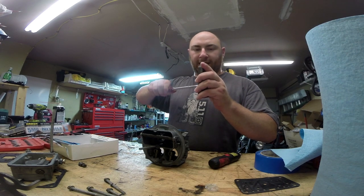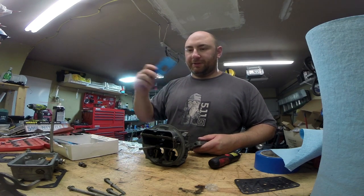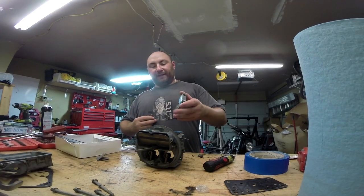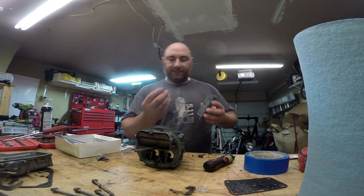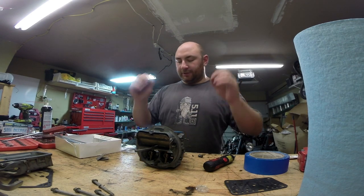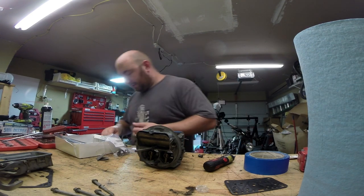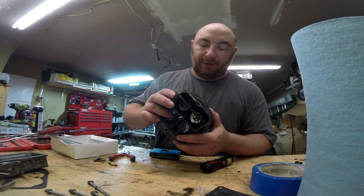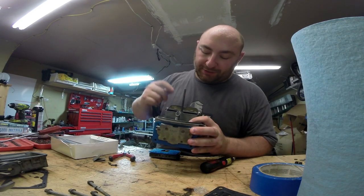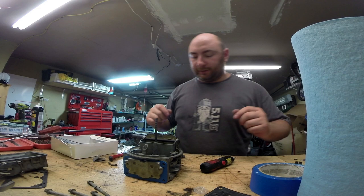We're going to put back the main jets that were in here — I talked online to people on forums and it seems like that's a pretty good size. Now there are a couple of gaskets that look like they could go here, but there's only one that does. This one with the little upside-down kind of hole is the one we took out of this location. Once you have the gasket laid down, take your metering block and your new power valve with a new power valve gasket on it — it's quite thick. Put in the adjusters which are lean/rich adjusters; this kit does not appear to have new ones. Remember there was a screw with little air passages in it — you need to make sure you clean those out. There's a new crush washer that goes between the screw and the body, and it's in the general little parts kit.